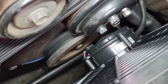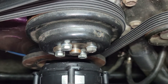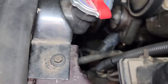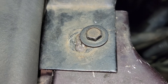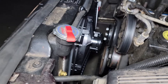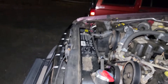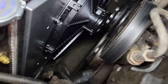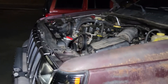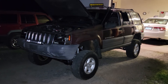The wiring isn't permanent yet, but you can see there is clearance between everything — you can probably fit a finger in between. It'd never work if you had just the studs in it. My brother re-drilled the holes here to move the whole metal assembly a little bit further forward to give that extra clearance — all that does is tilt the radiator forward just a little bit and moves your hood striker forward, but everything works just fine. This one runs nice and cool all the time — just what the doctor ordered.